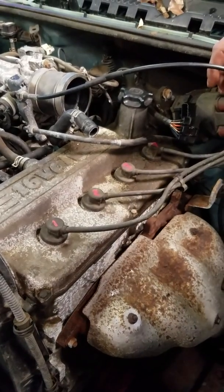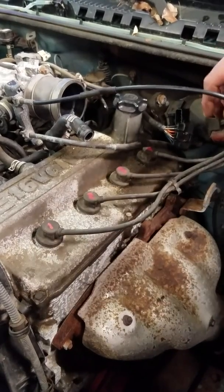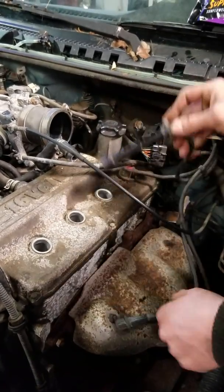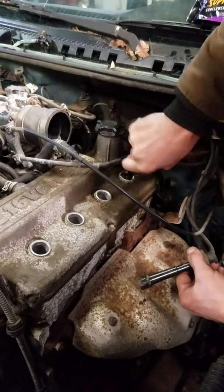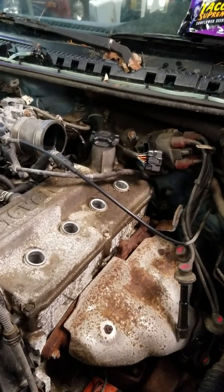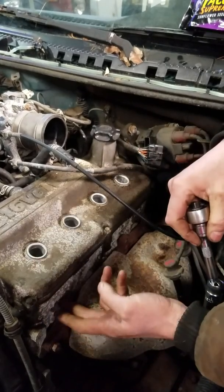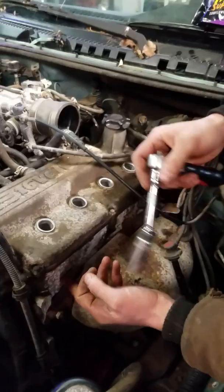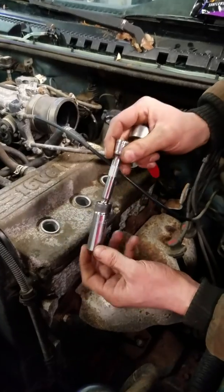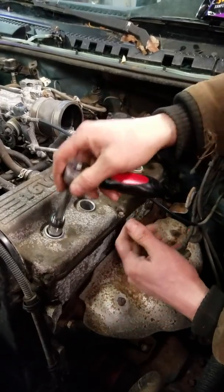So I've got these all labeled, and the next thing you're gonna do is pull all four plug wires and then the spark plugs. Next, grab your spark plug wrench socket. In the 16-valve engine they are buried down deep into the cylinder head, so I've got a longer extension — this one's got a magnet in it, which is real nice. It pulls the plugs out very easily and you don't have to worry about them getting stuck in there.